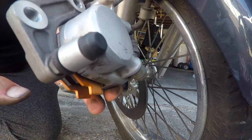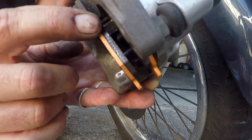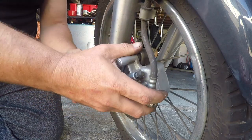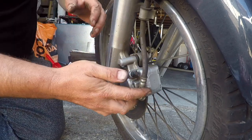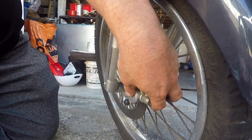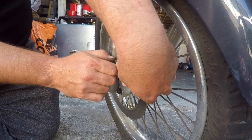So if you ever find the brake reservoir empty, don't take the cap off and put brake fluid in it, because you'll find that your brake pads are wearing. And when you go to replace your brake pads, you've got to try to take some out.